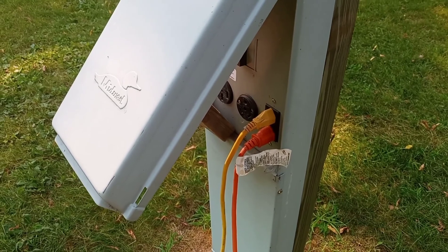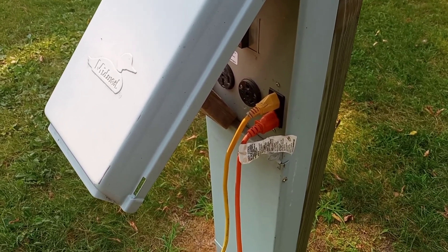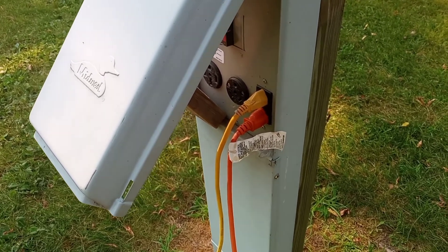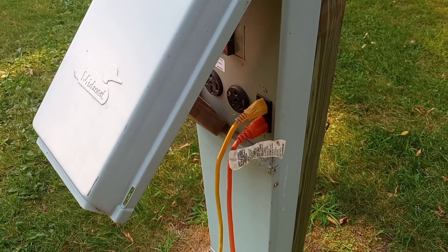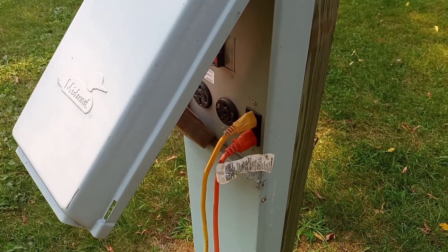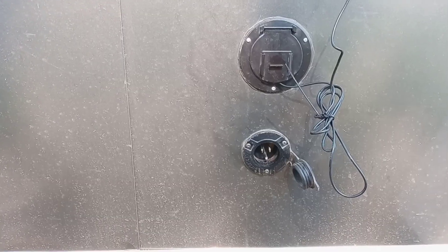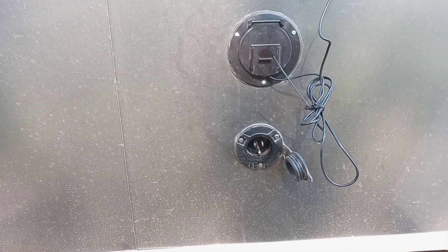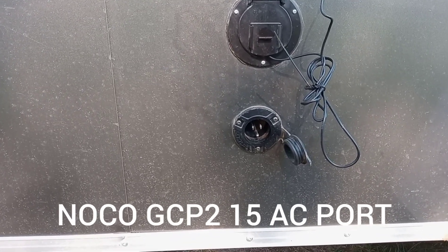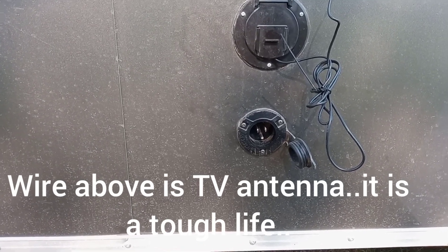Here's your typical RV pedestal setup for those that have camped quite a bit. Super simple. Right to left is your 20 amp household service — and that's all we're using, with a little trick and a twist I'll explain shortly. Your middle one is your 30 amp, and then the one furthest to the left is for the big boys, the 50 amper. And there's our connection on the bottom, the NOCO 15 amp. This happens to be a twin pigtail on the inside, so you'll have two female outlets that we'll cover when we go inside.